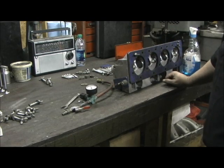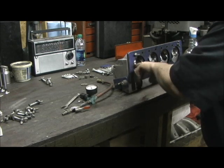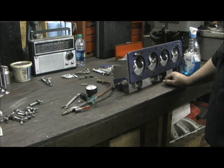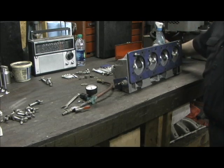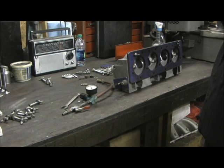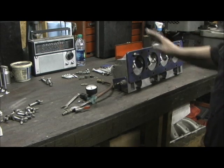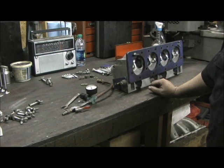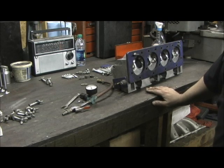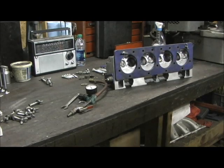With a runner volume of 197 CCs, that wakes you up — because that means I hit it 27 CCs hard over what it was stock. It's 100%. Off they go. I will show you one last time when I'm assembling the heads — the springs layout and the intake manifold. These will leave in the morning, UPS back to their destination. Pressure tested. Valve leak tested. Every trick I know to do to them. And not a bad price for the job. All you machine shop wannabes out there, eat your heart out, buddy. HeadBot signing off.